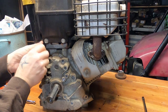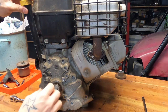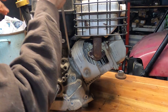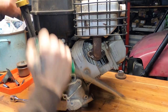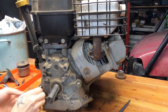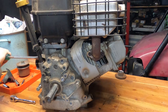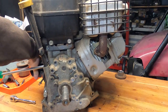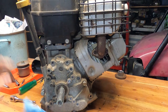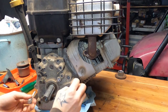There's a 5/16ths right here to get that out. I want to take apart as little of this as I have to because if I can just slam a connecting rod in it — it probably needs a piston and obviously a bearing. Let's put two bolts back in so she doesn't go flying if we break her loose. There we go — so far so good on the oil spillage, looks like just a couple drops. You gotta wonder if lack of oil has to do with the reason why she's here right now.